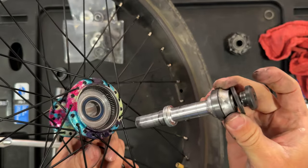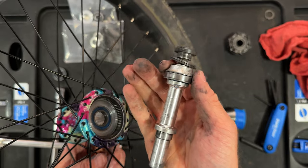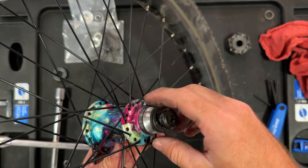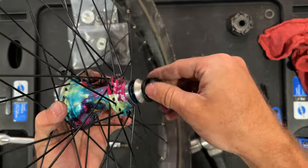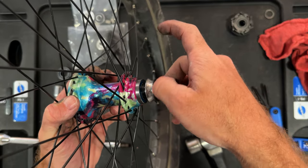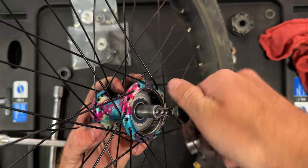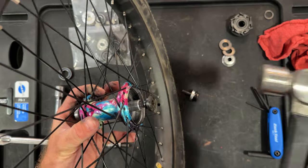Back to this hub — we've got the axle out. We've got a cone spacer that is a little bit stuck on the axle, just like it was on the front hub. So we're going to flip the wheel back over, put the axle through, and hammer it back in and out through the other side, forcing this cone spacer off. Through a little bit of hammering, we didn't even have to put the bearing all the way back in to get this cone spacer to come off. We take our axle nut off, flip it, put it onto the drive side, tighten it in making sure it's not going to hurt the threads, and then hammer that back out.